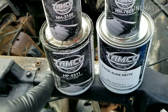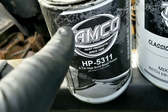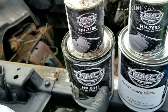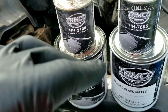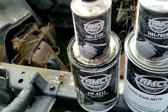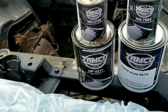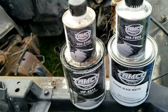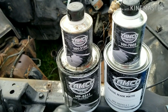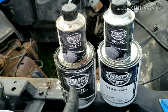I'll get the correct ratio in the editing of this video. I'm gonna spray the 5311 first - we also have the 5310 which is the gray. Then we have another one - I forgot the part number - it's a direct-to-metal primer, actually it's a direct-to-rust primer. You can spray it on rust, sand it down, spray this on and it kills the rust. It's proven to work for 10-plus years. I'll throw the correct part number in the description.